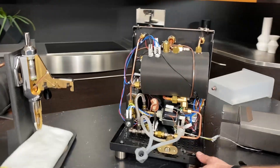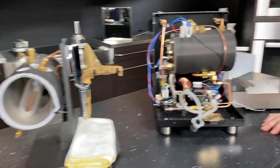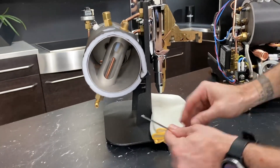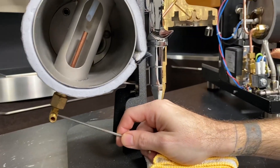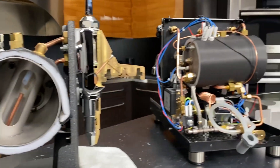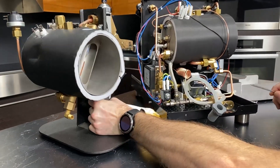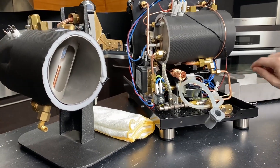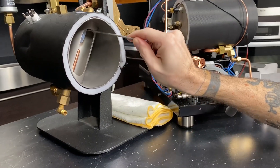Since this is a heat exchanger machine, let's talk a little bit about how that operates — what's happening really in that boiler. So once we got the cutaway — you'll see down here, this is where the water is getting introduced into the heat exchanger system. The water comes in this way, up through there, and it's going to go up into this tube right here.